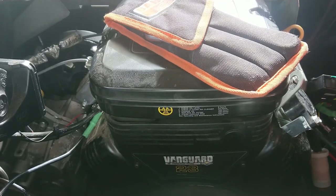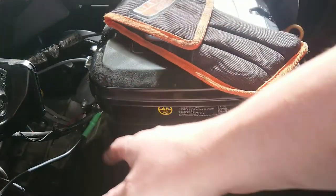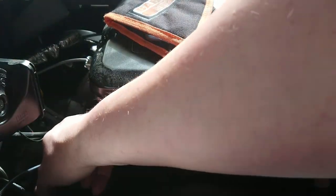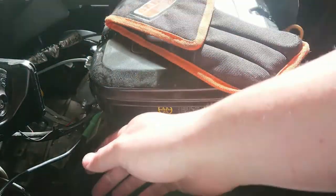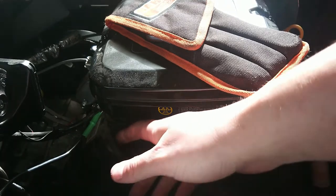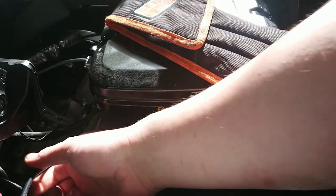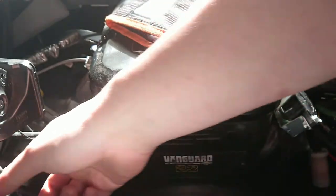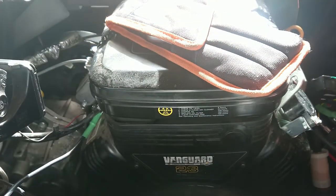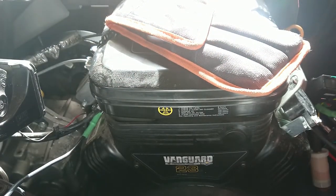Okay, so we've switched over to the other side of the Argo, and I followed the main negative back, and it comes to the engine first and then hoiks up here up to that negative rail. So the most sensible place of least resistance to go is straight back to that engine bolt. And we've run our cable up along and underneath here, and we'll zip that down.